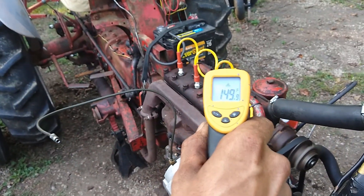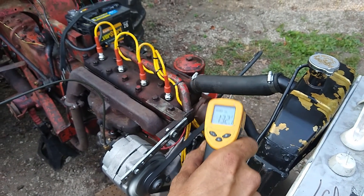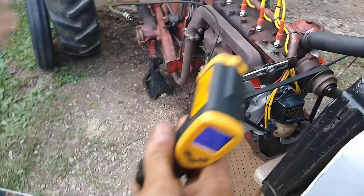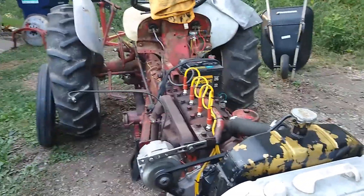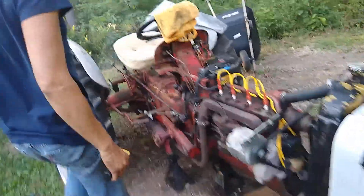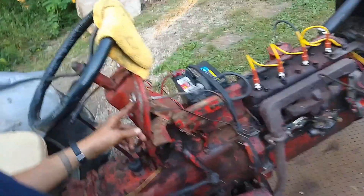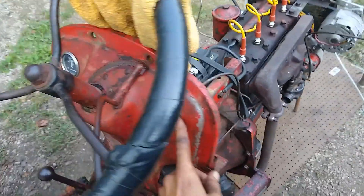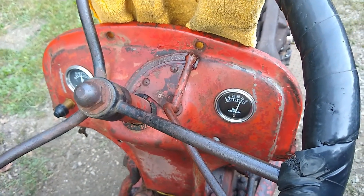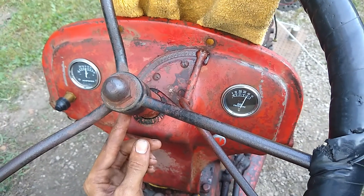About 150 at the head. 130 top hose. 90 bottom hose. It has a new water pump, so it's definitely flowing pretty well. Over here, still keeping really good oil pressure — that's at idle, a high idle, but it's about 35 to 40. Charging system's working fine. You're not gonna see much charge right now because there's no need for it — the battery's full.